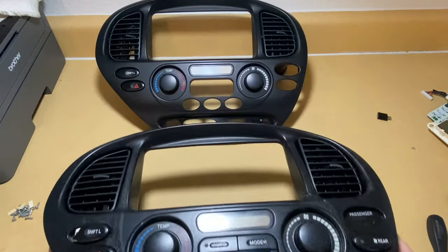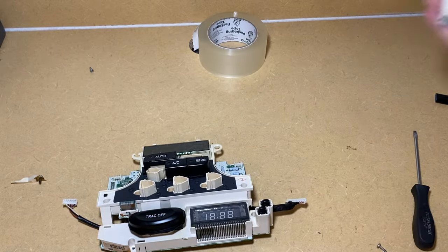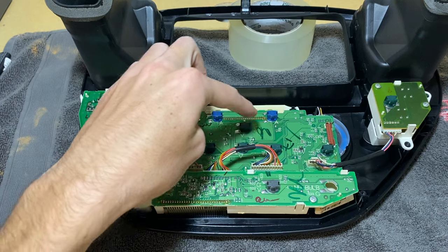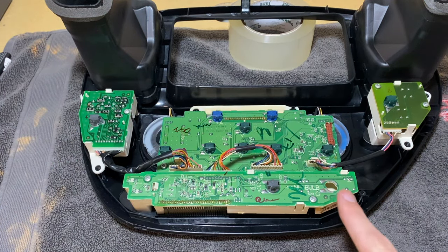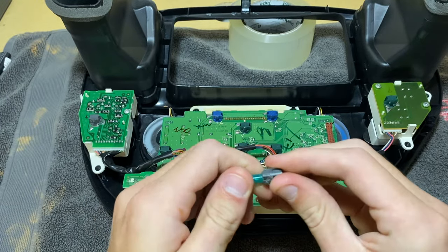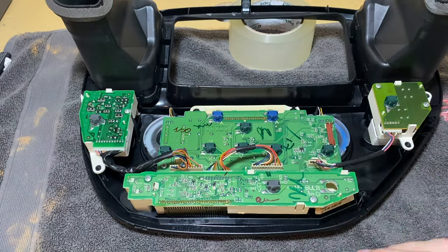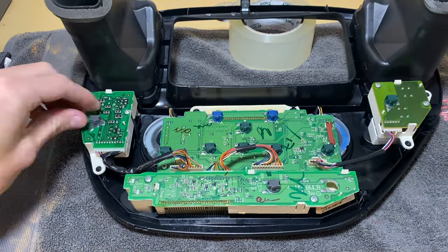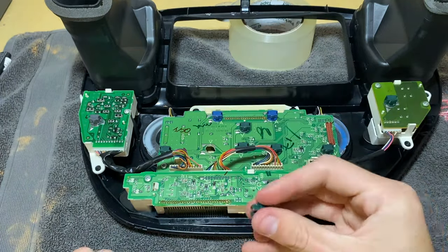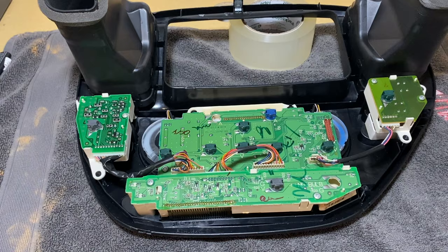While replacing the AC bezel I decided to also replace the bulbs with LED bulbs — I have a video covering the full LED conversion on my channel. I have some nice LED T5 bulbs from Amazon. There are 11 bulbs that need to be replaced: you just twist them loose, pull out the old halogen bulb with the green film, and put in the new LED bulb. It's important to note that for some of these lights polarity does matter — if you put all the bulbs in and notice one or two aren't lighting up, just flip the bulb around so the positive and negative are swapped and you'll be good to go.